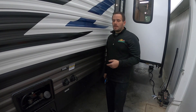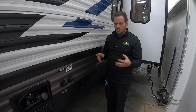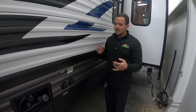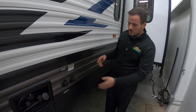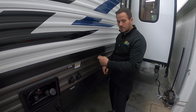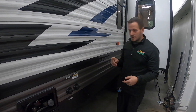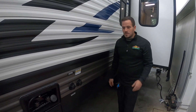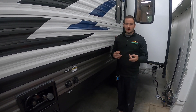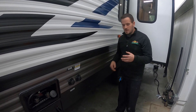You have your black tank, which is your toilet. The toilet is one of the biggest things to maintain on the unit. You always want to have water in the tank before you use it — you don't want things piling up because it will cause odors and can cause your sensors not to read correctly. The sewer flush connection: after you're done camping, you pull your black tank, empty it, then hook up a hose here, turn it on, and it shoots water inside that tank to help clean it out, spray off the probes, and help with the overall condition. You'll also want to use chemicals — Commando is one that works really well. Let that sit for 24 to 48 hours, then drain and sewer flush it.